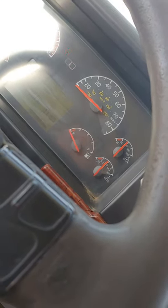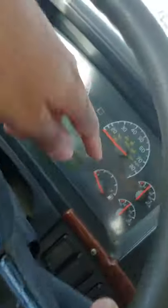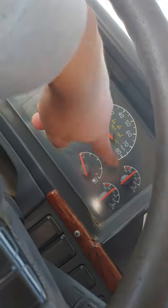Assuming one minute has passed, release the brake. This test is normal — the high-low is 0 pounds in 60 seconds. Still reading at 100.